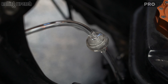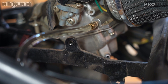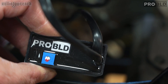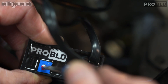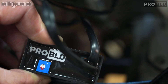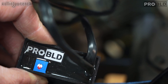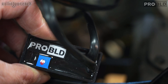Positive, negative, in-line with the tail light — very easy. Now all I have to do is turn the key on and the fuel pump will pump by itself. You can see how fast this sucker pumps. I can adjust the pulse rate — how fast or slow you want the fuel pump to pump — using this little flathead plastic screw. I've got a little red mark set exactly where I'd recommend for a GY6 engine. Put the microphone down by the fuel pump and there's an audible noise, so you know the fuel pump is working and you can hear the speed.